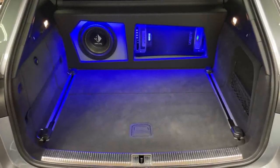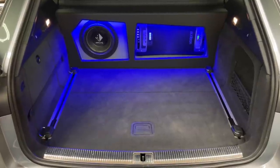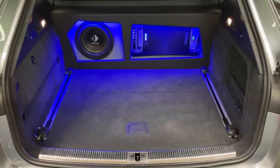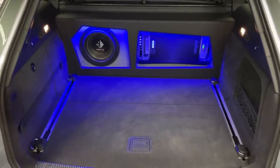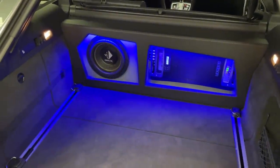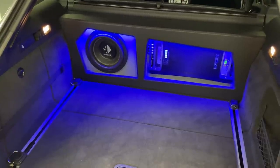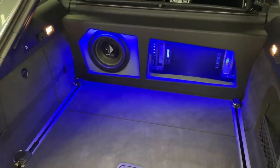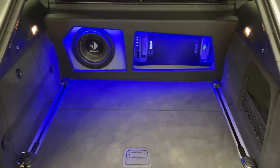But as with any system, we do extensive deadening to the trunk where you have the subwoofer, because we don't want additional rattle or anything coming alive and causing distraction. So we just built a sealed box over there. That's a 0.9 cubic foot, roughly 26 liter sealed enclosure, all made out of plywood. But that sub can be taken out easily. I will show you how it's bolted in. It can be taken out, and the trim panel can come out in literally like 10 seconds as well.